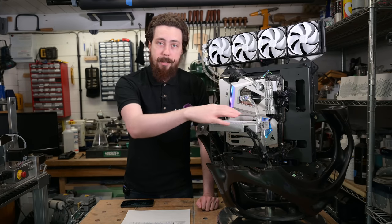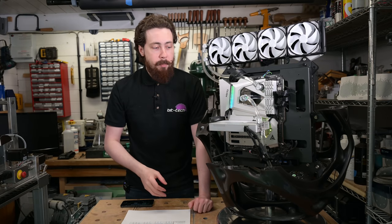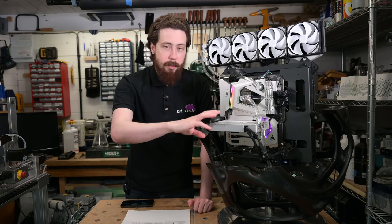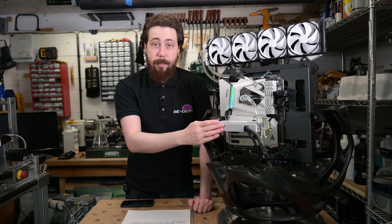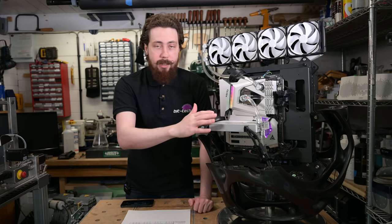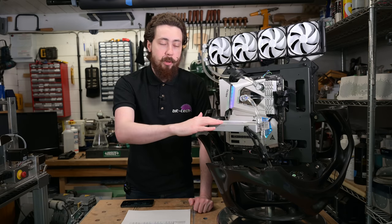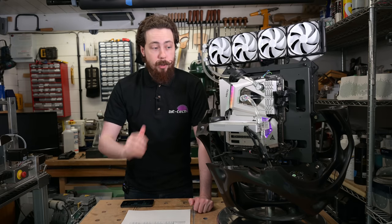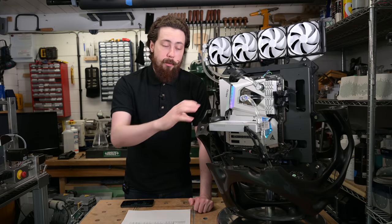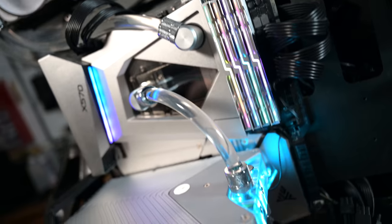It would involve me having to take this off and put maybe an insulator in between the two to basically ruin the thermal contact. My inclination is that it doesn't do a whole lot, but in any case, the fact that this is a solid, pretty hefty backplate with all this ribbing on the backside here, which adds quite a bit of surface area, this is going to be a well cooling backplate, and it obviously makes good contact with the memory modules, and it makes quite a sizable difference. It knocked 30 degrees off, or 40 degrees off in some cases, from the T-junction temperature. So that's pretty good, and in my eyes, fairly conclusive.